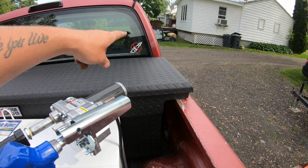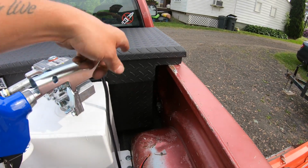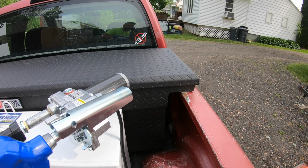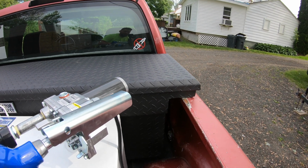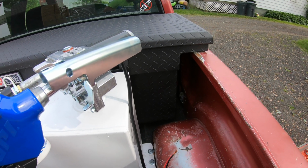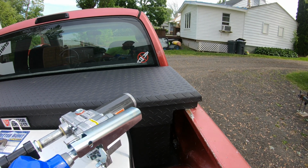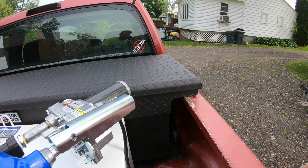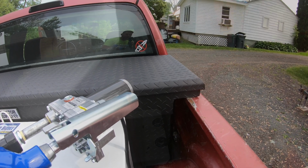because my truck's got 2 batteries. I'm gonna use the one on the right side. It just makes more sense. That way I could just do a straight run right to it. So what I'm gonna do is drill that hole, and then I'll show you guys me connecting the battery. But every truck's gonna be different here. If I were you, I would just drill a hole through the bed, find the easiest path to get to your engine bay, and more than likely your best way to route it up there is to use the channel in the frame and just zip tie it along the way.